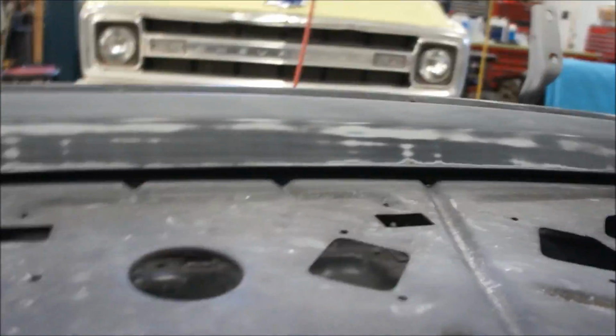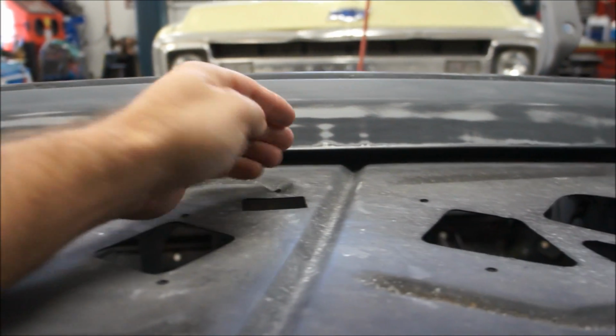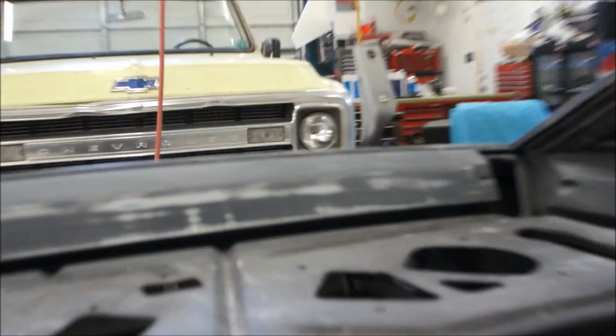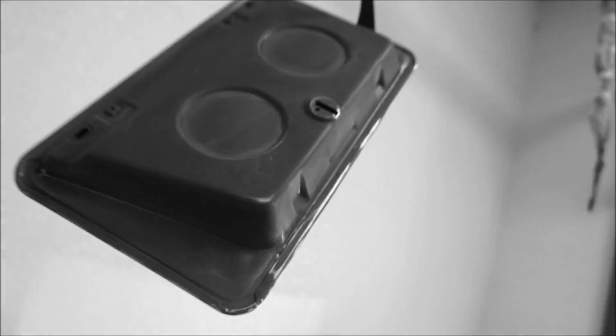as you can see, it's not exactly straight. You can see the lines where it bent, you know, when they pressed it and all that, and since it's round, it had to compress a little bit, so you can kind of see some of those areas. I don't know if I showed it a while ago, but it's nice and smooth now. Blocked it out. Just had some light blemishes. It wasn't completely perfectly straight, so I went ahead and did that. Took a 320 to the back side, and so it's pretty well ready.